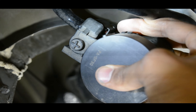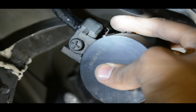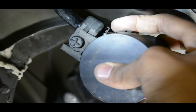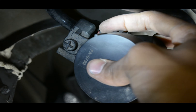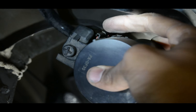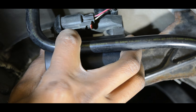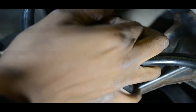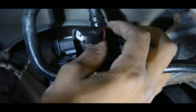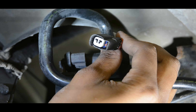This next part was just a little bit difficult, because it was such a small area to work in. Next you have to disconnect the cable from the solenoid itself — that's where my flat head screwdriver came into play. You have to flick back a piece located inside. See that little section right here? Push back that piece so the cable can unconnect from it. I know that looked kind of easy but it took a couple minutes.